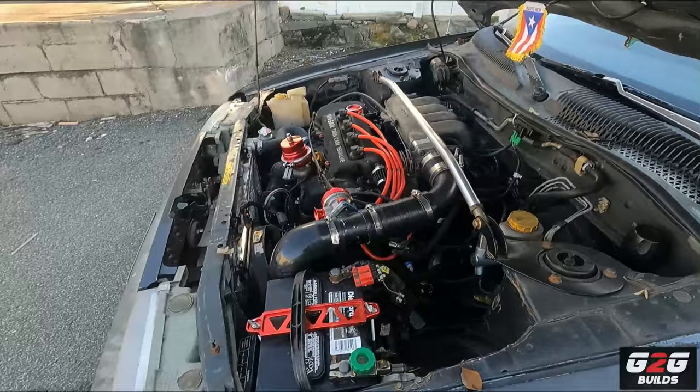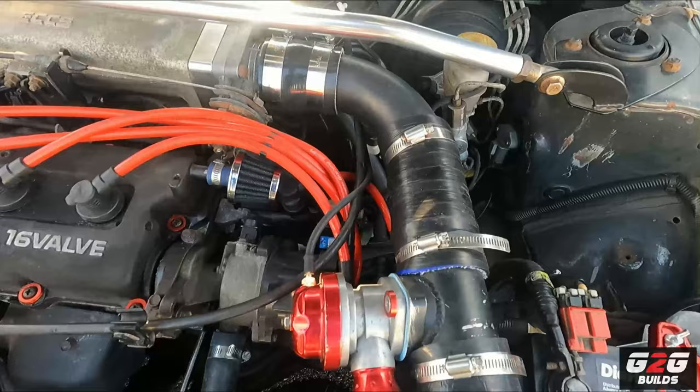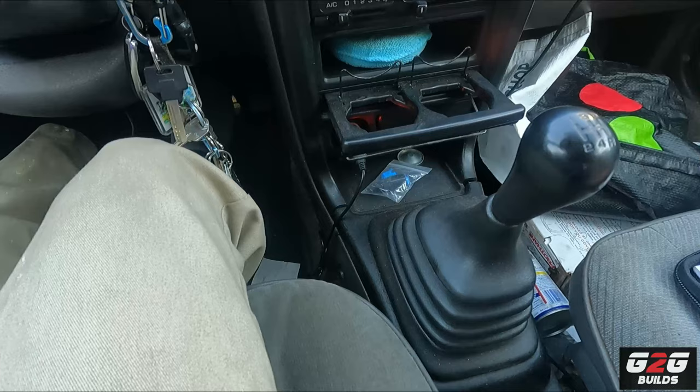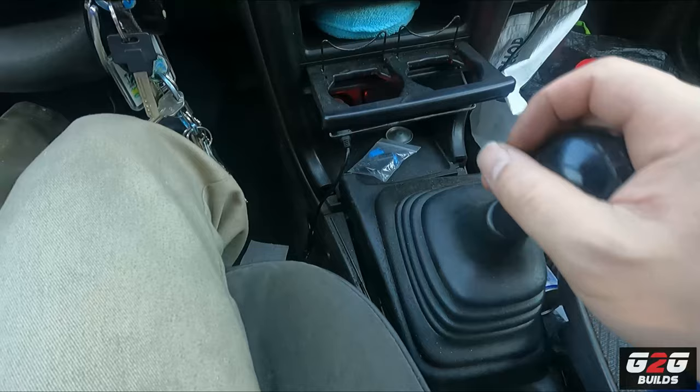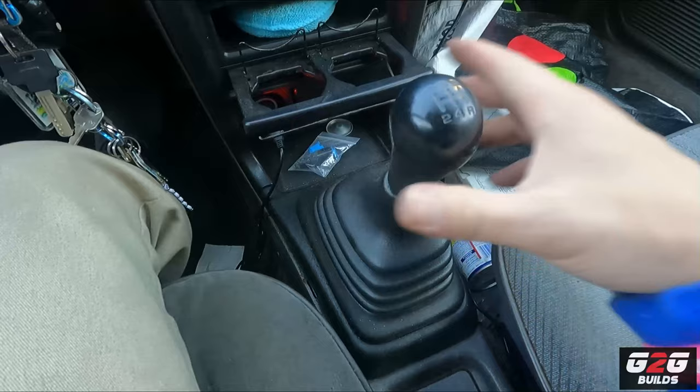It's been a few days after the last clip and the car is done - I'm gonna show you right now. The car is back together and everything looks powered up. However, the car is not going into every gear as it used to. It goes into first and second, but when it comes to third and fifth it feels very very hard and it doesn't want to go in.